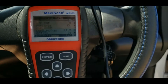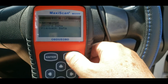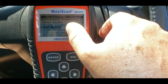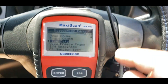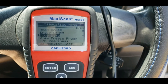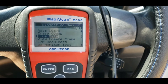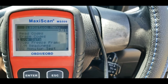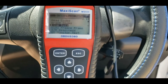There's a lot of things this tool can do. Originally I bought it just to clear the codes and check what was wrong with the Toyota Yaris, and it did that right away. You can read the codes, you can erase the codes. If you get a check engine light on your dash, it'll give you a code and what it was. For example, on that Echo it was the evaporative purge valve — you replace the purge valve, the light goes off, then you erase all codes.